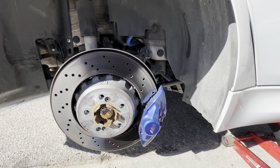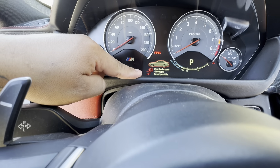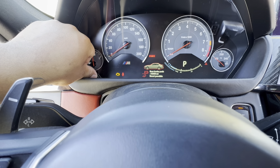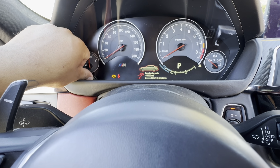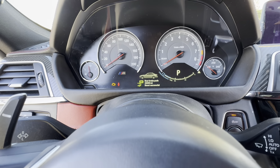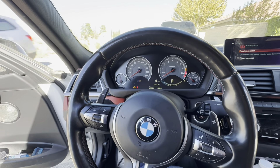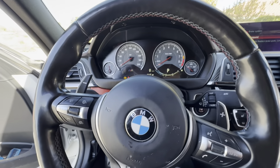There's a little button over here — you hold it twice and it says 'reset possible,' so you press it. Going through the menu real quick. Brake pad reset possible — you hold it down again, reset yes. Reset in progress. And bam, just like that guys — rear brake pads reset successful! Now I should get rid of all these annoying little lights. Remember guys: change your brake sensors while doing your brakes — don't do it like me.